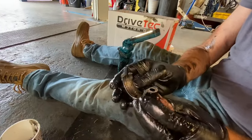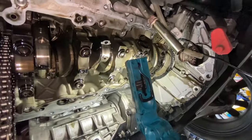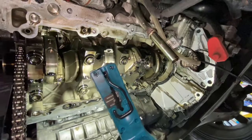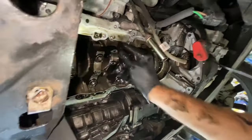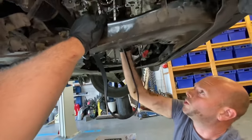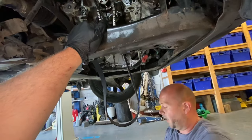There's no shell in there at all - it's completely gone. It could be stuck on there - yeah, it's stuck on the journal. I think we're going to have to spin the engine slightly to get a bit of clearance - turn the crank so that journal comes lower.